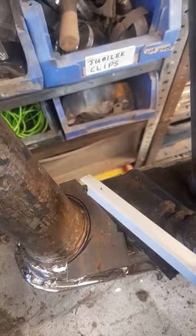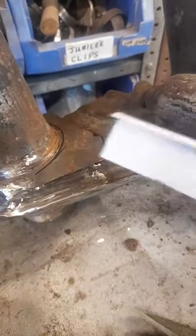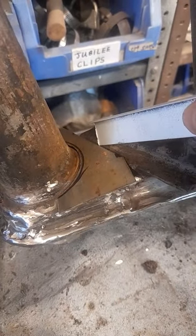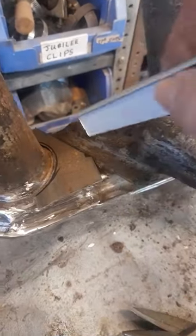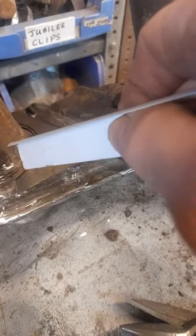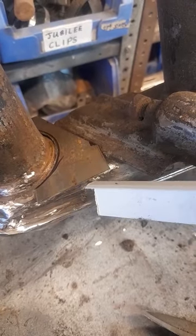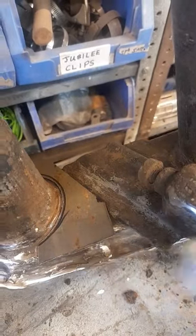So having taken this corner off, as you can see, we've got a little bit extra length here, which we're going to fold around. Going to use that section over there and weld that into there. Obviously that's the bump stop, so that's fairly thick. What we're going to do is just trim it around a little bit more, or file it off, profile this so it bends over, same at the other side, and make sure everything fits in there tightly before we start welding.